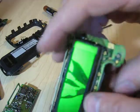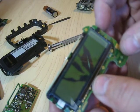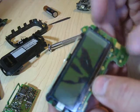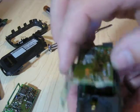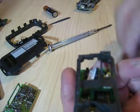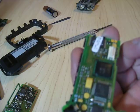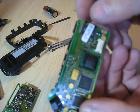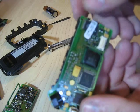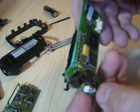Typically you're going to have this kind of problem — somebody dropped it, it's cracked. The LCD is probably not serviceable, but to get to it you just pop off the receiver again and take off the little battery thing. What you're left with now is just the main board and the display. The display has a couple of clips on the side and one on the other side, so it just pops off.